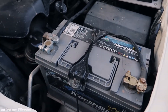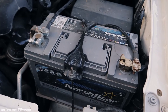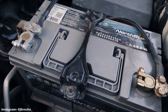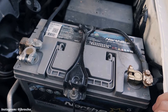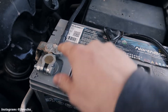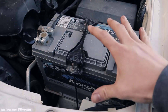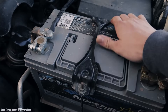It's a little windy out here, hopefully the audio isn't too muffled. To start, I've got a North Star Group 27 AGM battery. I should have ordered the 27F — I knew that when I ordered it, I just forgot. If I had gotten the 27F, the positive terminal would be on this side and the negative here, just like the OEM battery. This battery fits in here with no modifications using the factory battery hold-down.